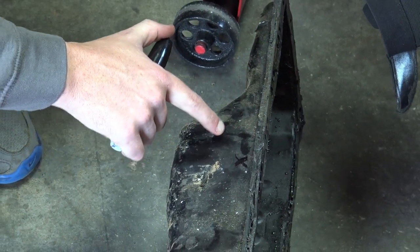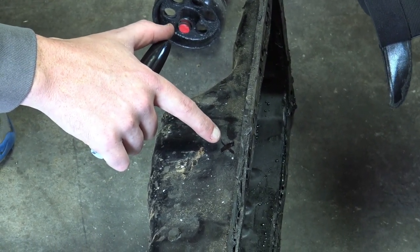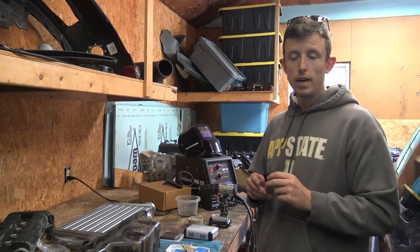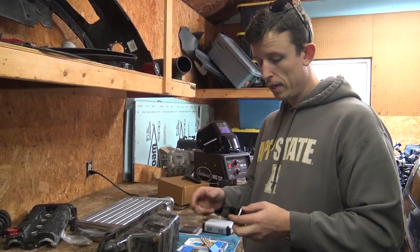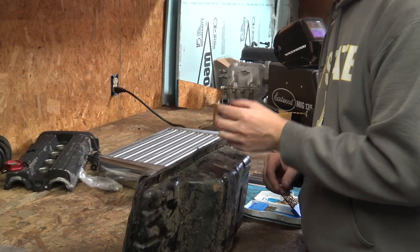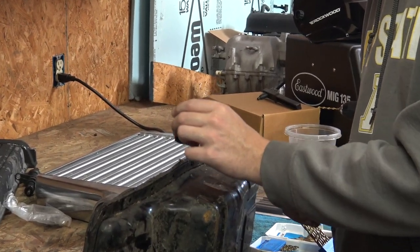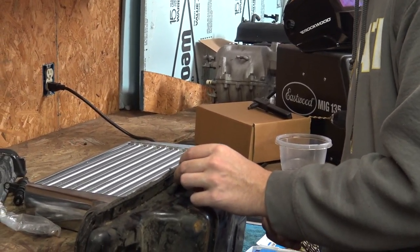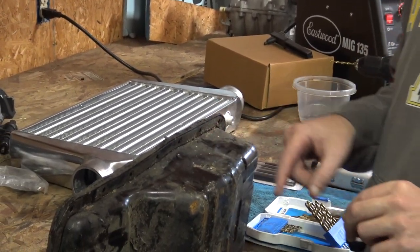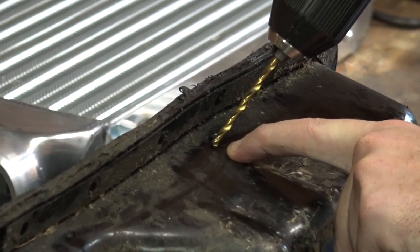All right, that's going to be the spot there — we're going just to the right of the previous one. Let's pull out the bits; we'll drill a small pilot hole and then start with the unibit and oversize it to fit the fitting. I've got the new oil pan over here. We need to make sure that when we drill our hole for this fitting, we have enough space and we're not too close to the top — we don't want to get into the flange. I've got a 5/32nds drill bit here; we'll go a pilot hole right in the center and then start with the unibit.